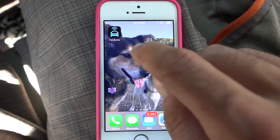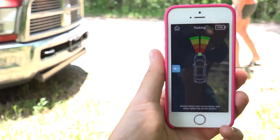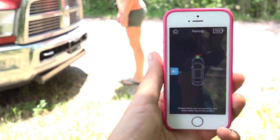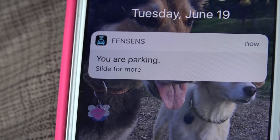Once it's all set up there are a couple of different ways to use it. First, you can go into your phone, select the app and open it up, and I find it brings up the sensor really quickly and starts showing how far away obstacles are on the screen. It doesn't actually give you a distance — it's just green, yellow, orange, red — telling you whether you're close to something. The second way is to press and hold the quick access tap button for three seconds. On an iOS device it will give you a notification that the app is running in the background. If your phone is unlocked it'll quickly open the app; if it's locked you'll have to unlock your phone first. Even when the app is running in the background and you can't see it on screen, if you get close to something you're going to hear it beep.